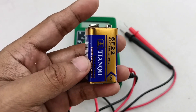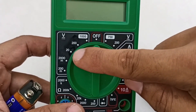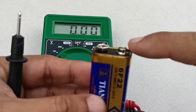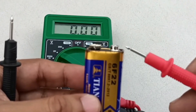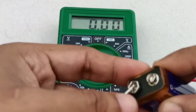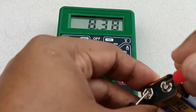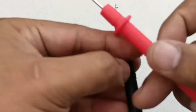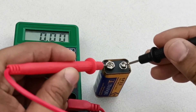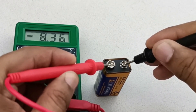Let's do a quick test on the voltage of the stock battery. Set the range selector to 20 of the direct current or DC settings. Use the tip of the test probes to touch the old battery's terminals. The multimeter will still give you the right measurement even if you use the red test probe on the negative terminal and the black one on the positive — it will just show a minus sign before the number to let you know that the polarity is in reverse.